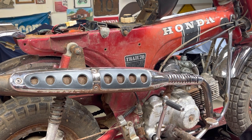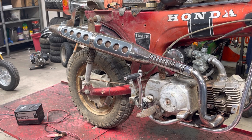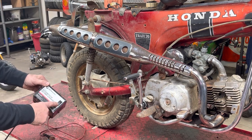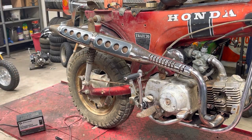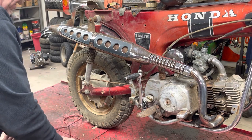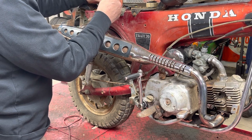We do have a lot of yucky nastiness down in there about where the coil mounts, so it may be a grounding issue — we may have lost ground between the coil body and the rest of the system. Let's check that. Let's grab a battery charger. So now we're going to bypass the rest of the harness and check just the coil. I've got a Schumacher one-amp motorcycle battery charger with a setting for 12 and six volts. We want to make sure it's on six volts since this is a six-volt system. We're going to unplug the connector again and stick our little pointer into the black wire that we determined went down to the coil.